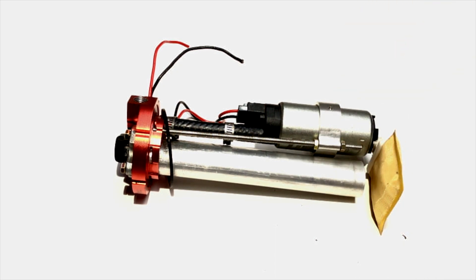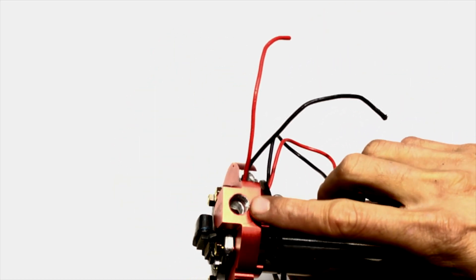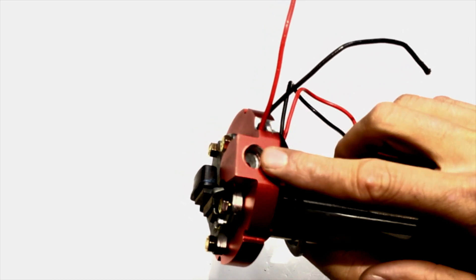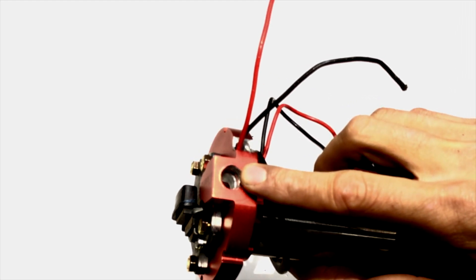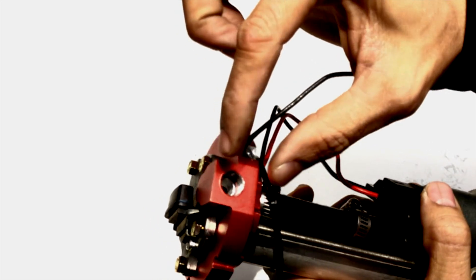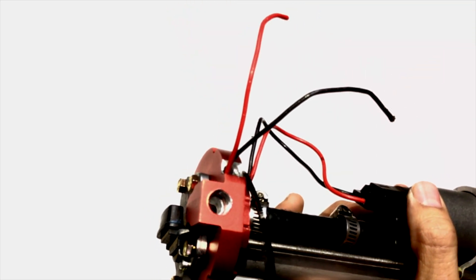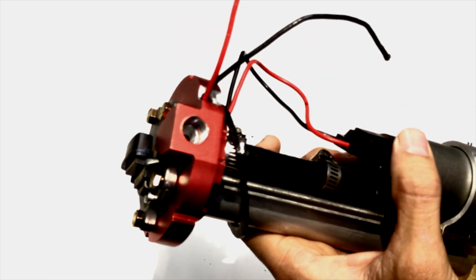You'll need to play with the fuel pump mount a little bit to make sure everything fits nicely. For the fittings, anything that's M12 by 1.5 you can use — so M12x1.5 male to AN6 or AN8. I think AN10 might be too big and could touch the bottom of the fuel tank. We tried the AN8 and it worked fine.